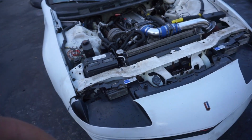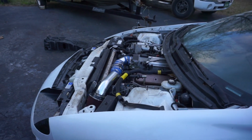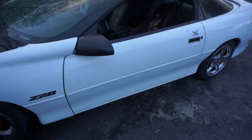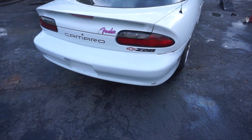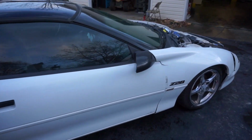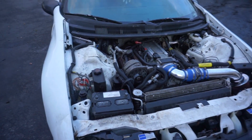Going to complete it for today. Only things I have left, probably just going to go ahead and replace the radiator. May just be those hoses down towards the bottom, I'm not sure. Figure out some stuff as far as the vacuum lines go, which won't take long at all, and replace the temperature sensor in it. We got it running, not running perfect. Obviously, needs a little bit of work, some fine-tuning. Get all that straightened out. I think I've got most of all the crap that we had put in there burned out at this point.